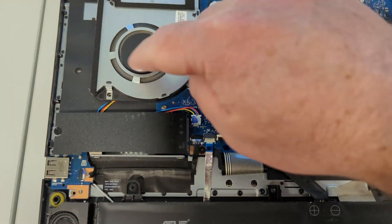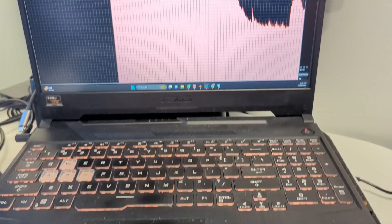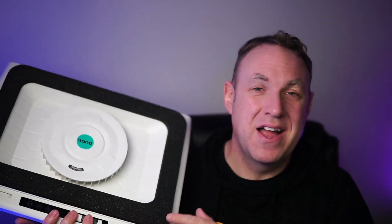Something really important to bring up: I do this for a living and I have replaced so many fans on laptop computers. When they run hot, the fans go crazy, they collect dust, and after a while they just don't work as well or they make noise — this is not healthy for your computer and will degrade its lifespan. Having an external fan like this, as I've shown, helps out a ton. Keeping your laptop cool prolongs its life, and not having the internal fans run so much keeps them lasting longer. If you do video editing or gaming and want to preserve the life of your laptop, this is a great way to do it. Just note — this thing is loud. You'll want noise-canceling headphones, unless you enjoy the nice hum of a fan.